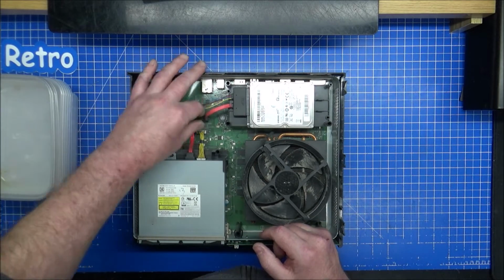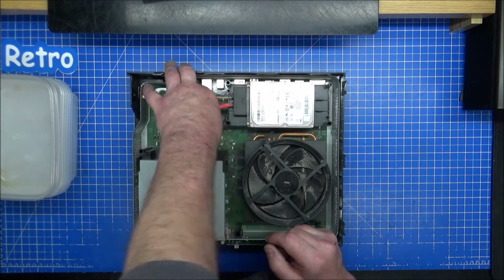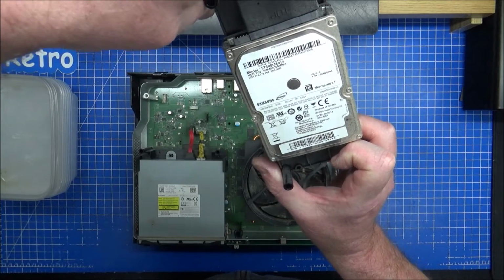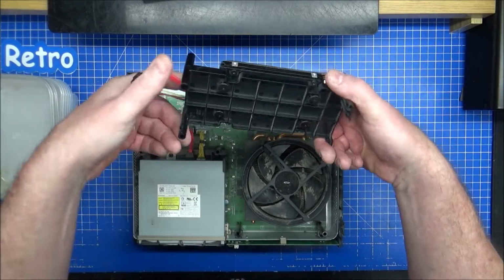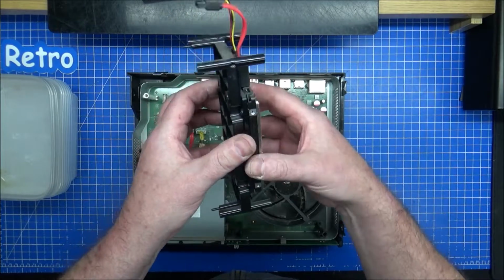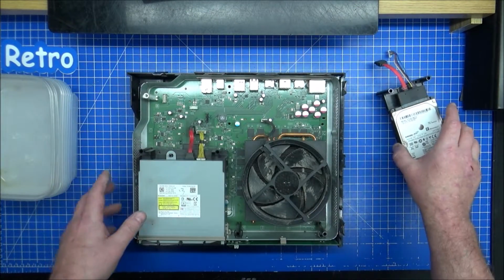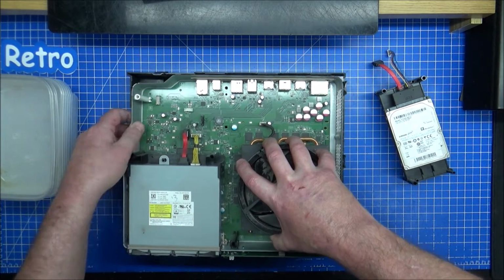It's amazing this works. So, disassembly. Pull out the power. Pull out the SATA, squeeze the clip, if there is, no there isn't, and lift out the hard drive. This is a standard 500 gigabyte Samsung, fine, got all these details on there. If you want to replace it, these four screws here come off, take out, put in another hard drive, SSD, do what you want. Fan, I think this is attached, actually we can take that out of there.